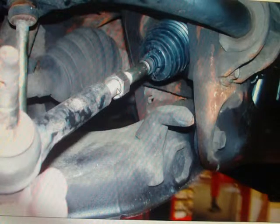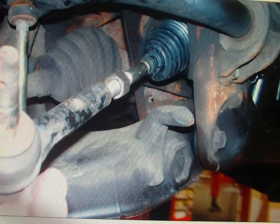What you'll do next is remove your tie rods off of your steering rack, because it comes without your tie rods. So you back the nut off just a tiny bit, then you give revolutions and you unturn your tie rod and you count. One side here was 30 turns, so then when we put it back together, we put it back 30 turns. That'll bring it right up to the nut, and you cinch it and you're back to where you need to be.